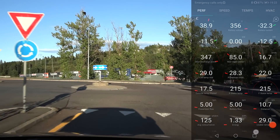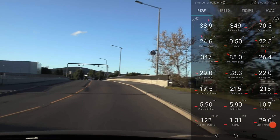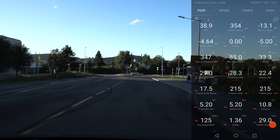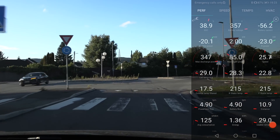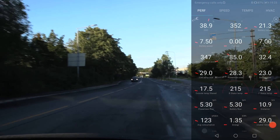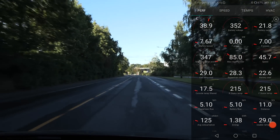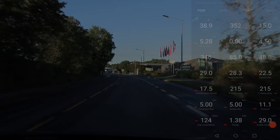That's it — 29 kilowatt hours. But there might be some decimal fractions beneath it. We only pulled 1.3 kilowatt hours and see 11 kilometers. When should we actually stop counting? I'd say 11 kilometers of range with this setup. Look at this — 123 watt hours per kilometer — because this is a Tesla. It's really efficient and we've been kind of semi-hypermiling at 40 to 50 km/h. Really efficient this model.